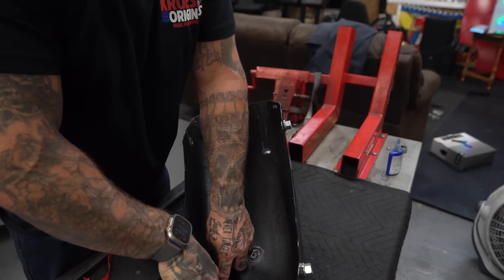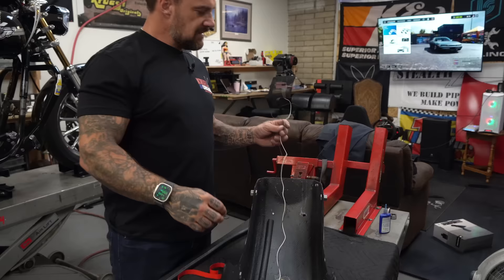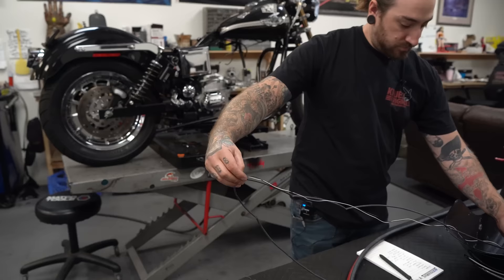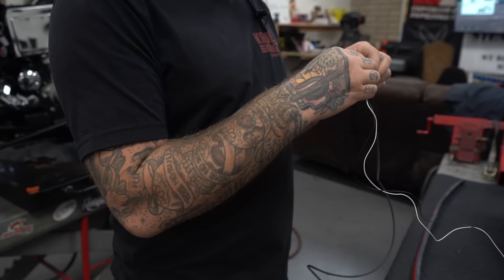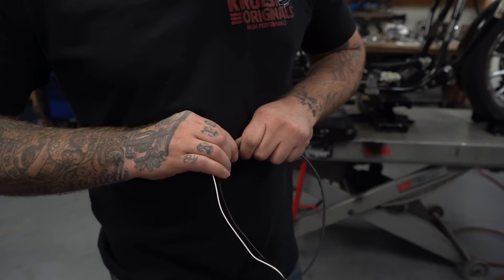You want to clean the inside of the fender out with some alcohol or brake cleaner — something to get it extremely clean. I'll throw some heat shrink on this dude — heat shrink down to like the last four inches or so. And then we got a little exit hole right there. Early 2000s factory. I'm just measuring out the heat shrink I'm going to need for this. When getting wires through wire loom, it's always kind of a bitch — you can push it through, but with how thin these wires are, they're not solid enough and they always bend once they meet any resistance.